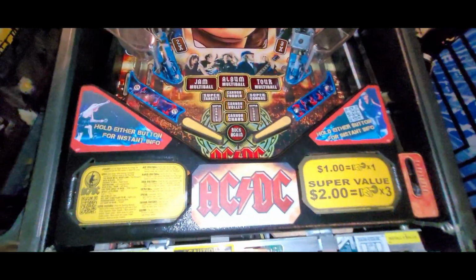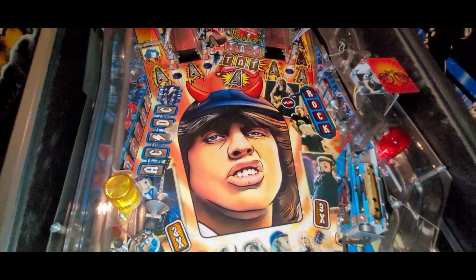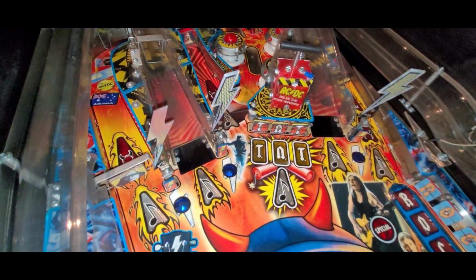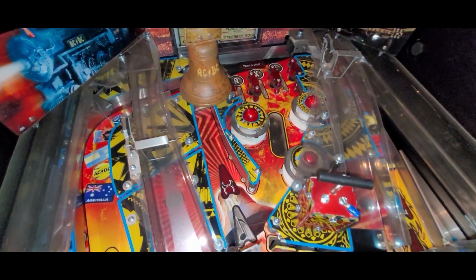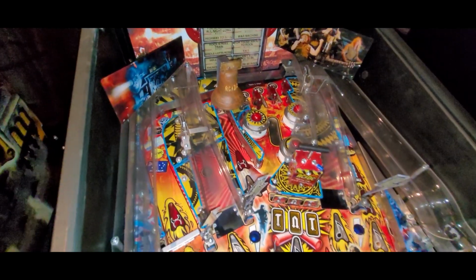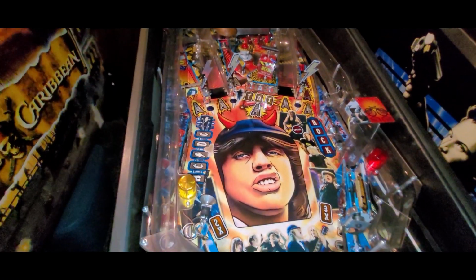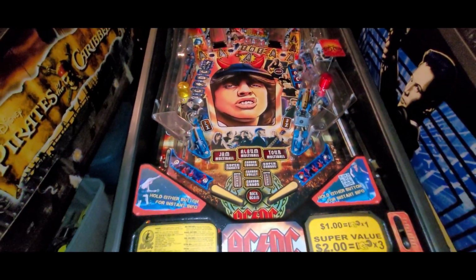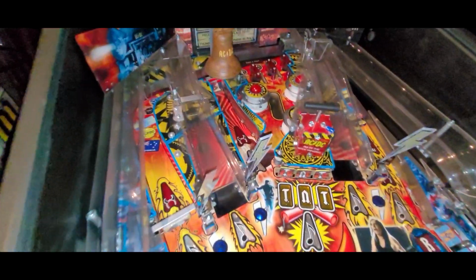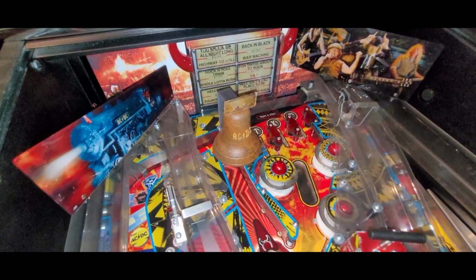All right, let's have a look at this playfield one last time. Because the goal now is to, well, let's see, what time is it? I don't know. Let's just say 5 o'clock. And I probably will have some shenanigans over maybe 8 o'clock. I think that's what I'll plan for. So that'll leave me 3 hours, roughly, to try and strip this guy down as best as I can. So the first order of operation is to lift the playfield, disconnect all the connectors that feed down for the flashers and switches on the ramps and stuff like that, label those connectors, and then start tearing it apart. So other than the 2 ramps, I don't see much complication at all. So let's just see how much progress I can make in however much time.